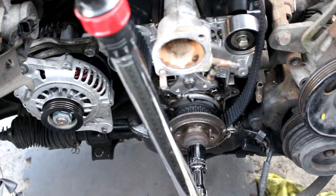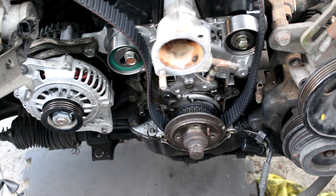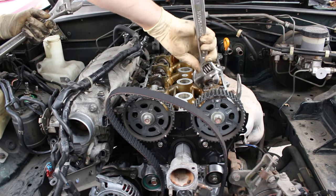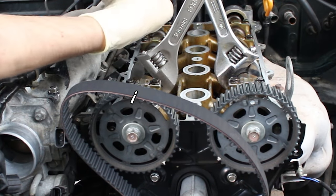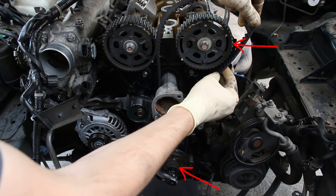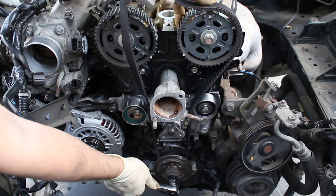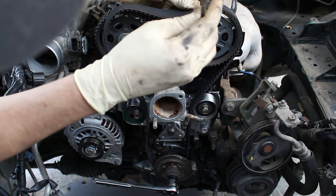Put your timing belt guide on, and next comes the part that everyone is afraid of — but don't worry, Miata Dad is here to talk you through it. It is not very difficult. There are a hundred different ways to do this, but this way is pretty beginner-friendly. The first thing I do is rotate the crankshaft about a half a tooth counterclockwise. Then set up the trifecta of awesomeness to lock the cams at top dead center — that's the I on the intake cam facing up and the E on the exhaust cam facing up, both at the 12 o'clock position. Put the belt on the crankshaft and the exhaust cam gear. The reason I rotated the crankshaft slightly counterclockwise is so there's a little bit of slack between the crank and the exhaust cam gear. Then zip-tie the belt to the exhaust cam gear so it won't go anywhere.